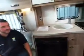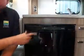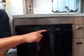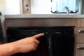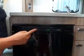Now, do you think your fridge is on? The only way you can tell is there's a tiny green LED inside. Last year's models had a big bright blue screen which dazzled you at night — they've changed that so you're not being shone at by a bright blue light in bed. But if you press the little gray button, it wakes up the menu. You can see a little flame lit and three of the bars — that means the fridge is running on gas, set at temperature three.